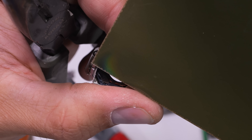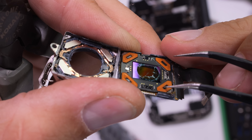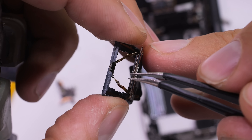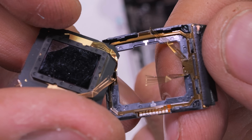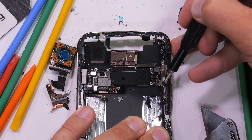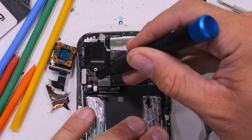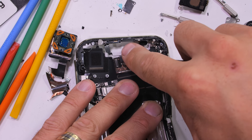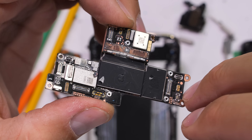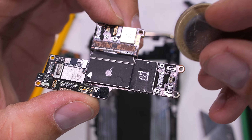It's really nifty stuff. Larger premium DSLR cameras have been doing this for a while, but Apple is the first one to miniaturize the technology and stick sensor shifting into a smartphone. So while indeed the iPhone Air only has one 48 megapixel camera, that one camera has some rather premium internals. Busting out our fourth screwdriver bit for the motherboard standoff screws — Apple kind of throws different sizes and shapes of screws in here willy nilly. We have a few more Lego style ribbon connectors that also need to be unplugged, and finally the motherboard is released. This has the new A19 chip inside.